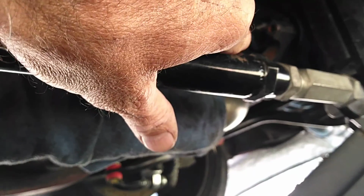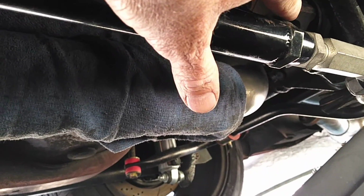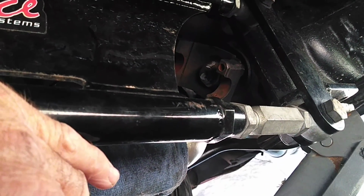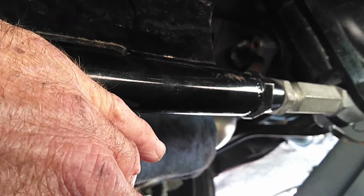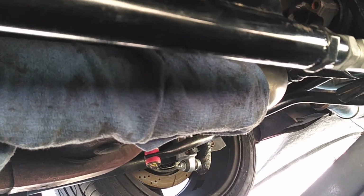I can't think of it right at the moment. With the nut, I just don't want to mess up and get heel or toe wear. It's straight perfect, you know what I mean? See how I've marked it with paint? I could take it off and take it off the other car, but I just don't want to go that route. The rear end hooks up really good, and I know messing with that pinion, if you don't get it exactly right again, you cause either the heel or toe or misalignment, and that's just not the way I want to go. It hooks too well.